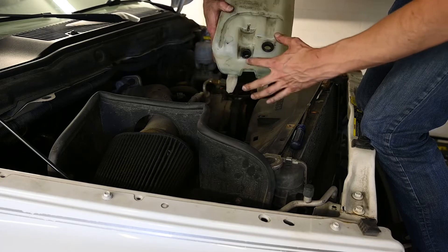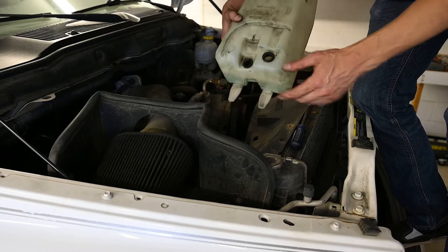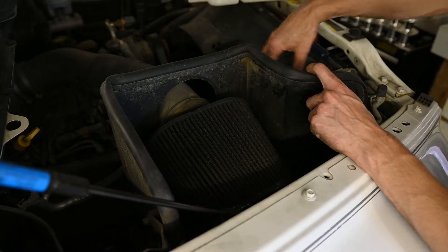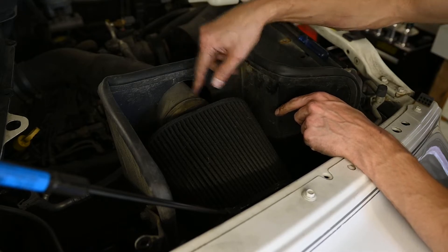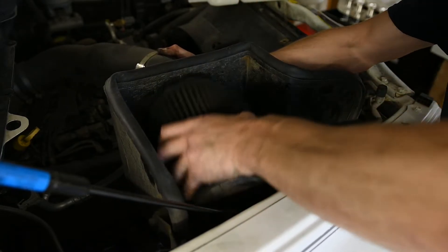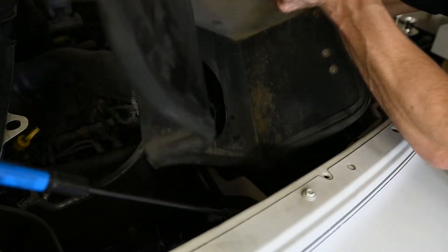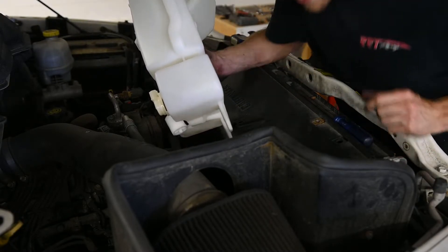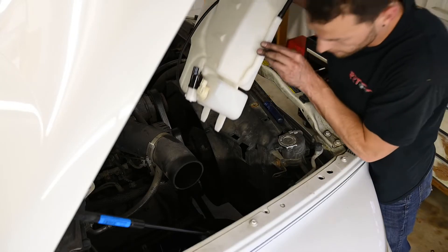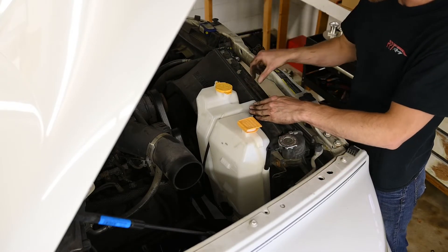I got it out. I left the sensor and the pump kind of attached to the wiring, but I'll have to undo those because the new unit has a new sensor and pump. The new washer unit is pretty big, and the washer with all the plugs in it is hitting up against things so I can't squeeze it through. I loosened up a clamp, took off a 13mm bolt here and an 11mm one over there. There are two notches at the bottom and one mounting bracket up top. Now with that box out of the way, it sits right in there, so I'll go ahead and get this top bolt back in and then worry about all the connectors.